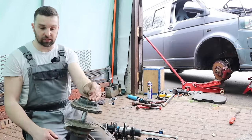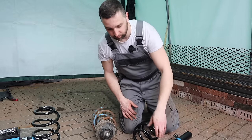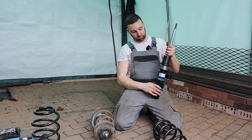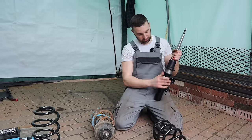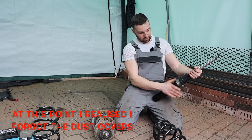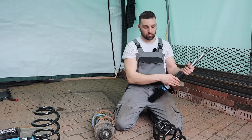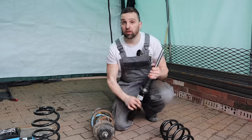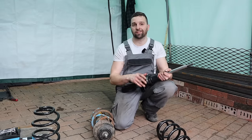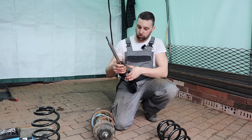All you've got to do now is basically mirror image this minus the snapped spring. For that it's going to be strut first, removing your top nut. The lower this thread is, the lower the ride will be. We're going to set it probably 20mm up. These are the Comforts so they're not the lowest kit - they're not like Solos or anything. This isn't going to be slammed but I don't run a slammed van - I'm going for more usable height.